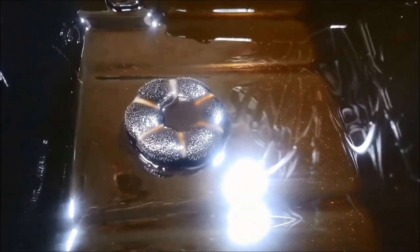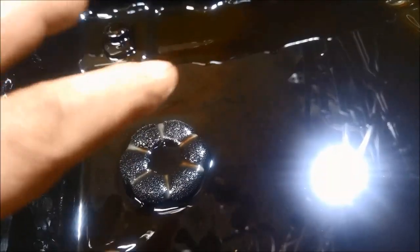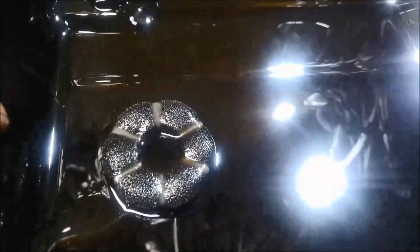You can see how much muck is on that magnet there. Once the magnet is contaminated like that, it doesn't have enough magnetic field to work anymore. So any material that's naturally created in the transmission during operation — instead of going to the magnet — goes to your electromagnets, which are your solenoids. The solenoids control all the shifts, pressures, sensors, and that'll reduce the life of the transmission.